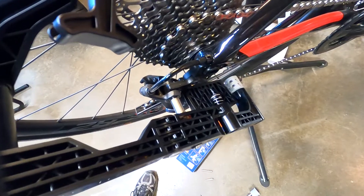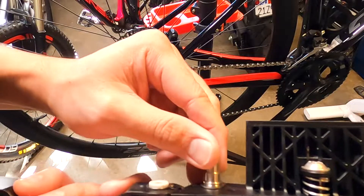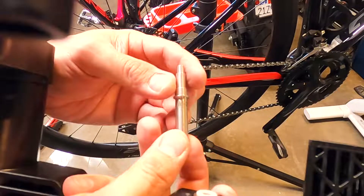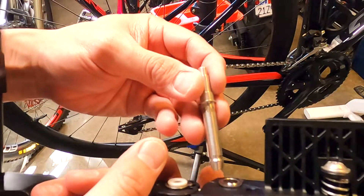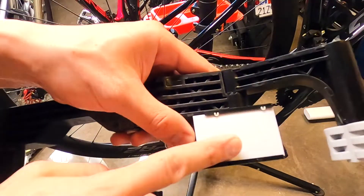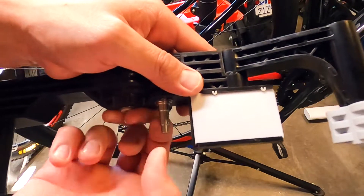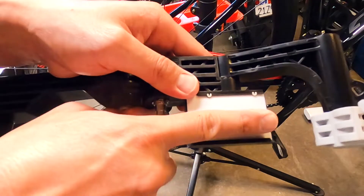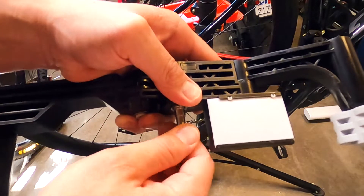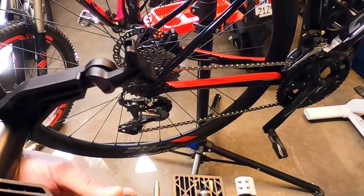I'm going to move the camera onto my stand now so I can show how the rest of it works. Remember when I was talking about the Shimano pin? I was using pin number one. I've actually switched to pin number two because the distance pin one was creating was a little too far for the derailleur to reach this pad. It was on the edge — too far. So the further the spacer, the further the derailleur gets spaced out. I had to switch to the shorter one, Shimano dash two, and now the derailleur will sit right here.